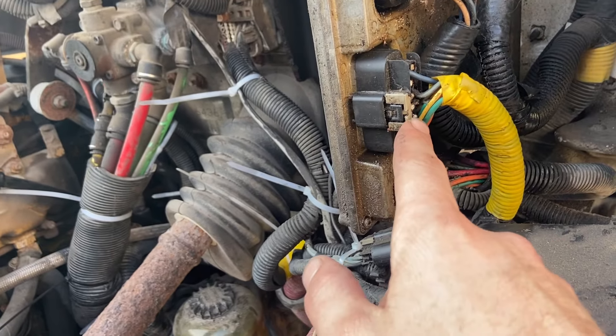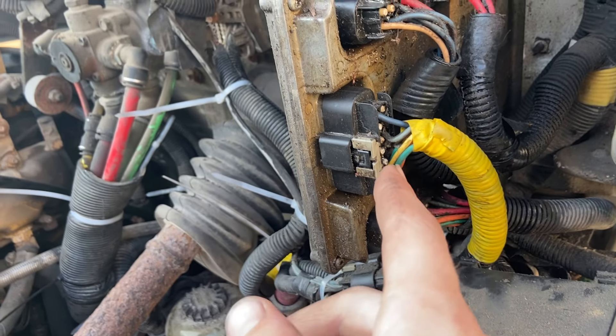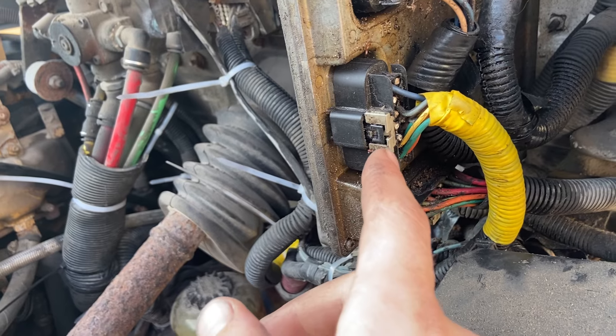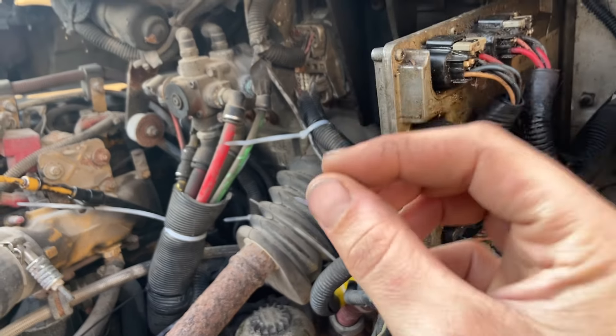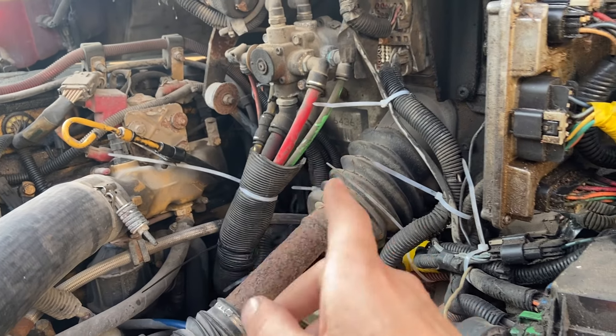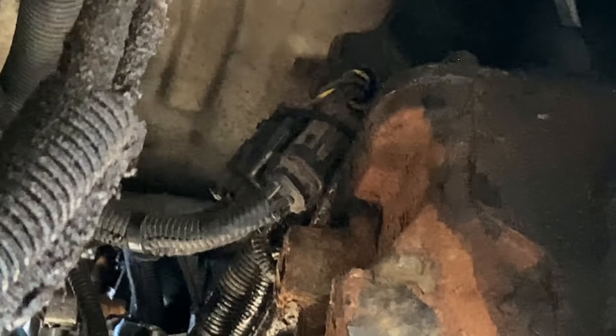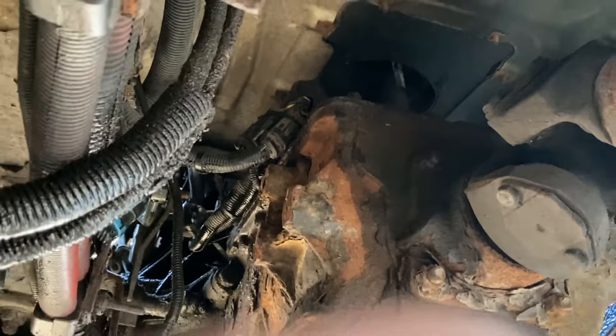What it was, was a broken green CAN wire - I don't know if that's CAN high or CAN low. If you open up the loom, it's a twisted pair - the yellow and the green get twisted up and they go inside of a black sheath that then runs through the harness. It goes from here to the engine control module, then comes out of the plug and goes down the harness. The place we found this break - you might have it on your truck too - is right up in there. You see that connector at the top of the transmission? The wiring was rubbing on the edge of the transmission and it rubbed right through that green wire.